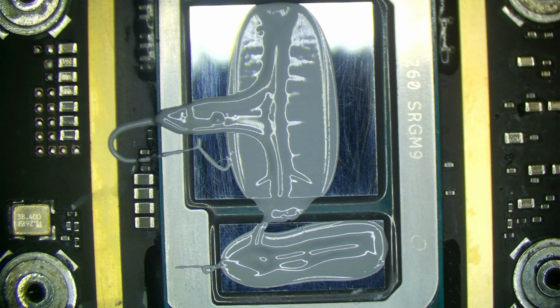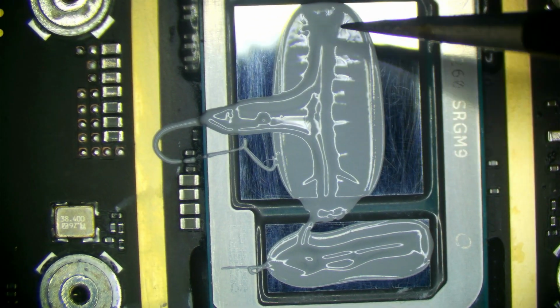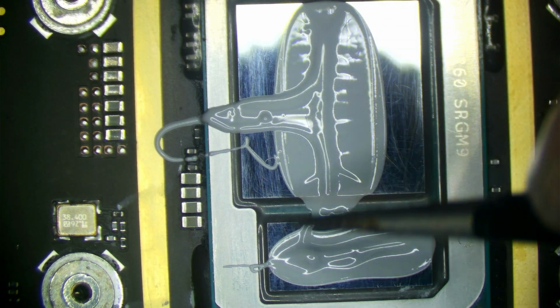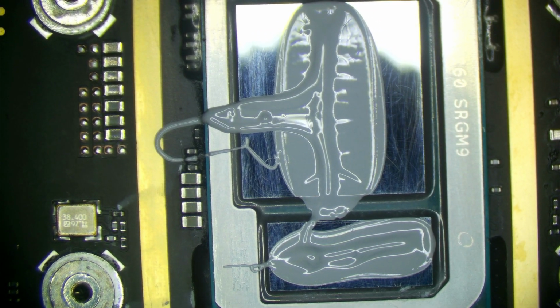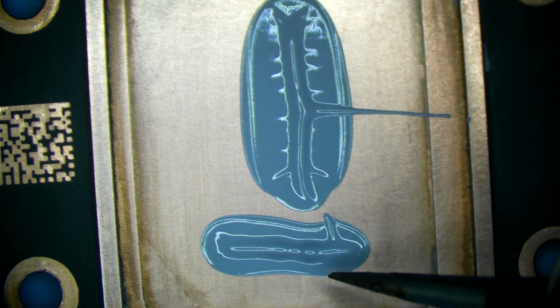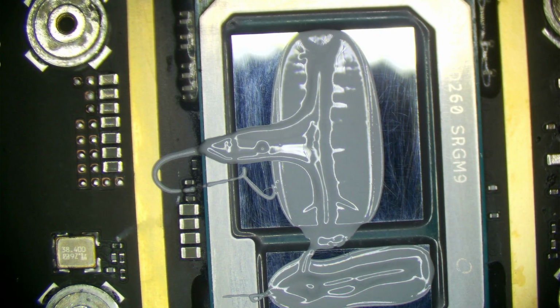Now, spread patterns can vary from brand to brand, but most of the off-the-shelf thermal compounds will result in something similar to this. You'll see a little thick line down the center of where you apply it, meaning that it wasn't fully squished out and the heatsink was not making full contact. We can see the same thing if we look at our heatsink here. We can still see our application line that we put on the CPU, and the same thing right here. So the paste was making some contact, but it was not contacting the die fully whatsoever, and this is not a good thing.